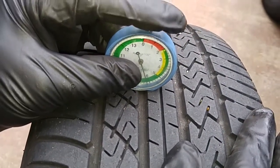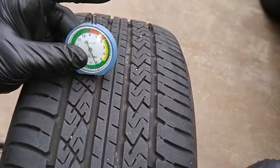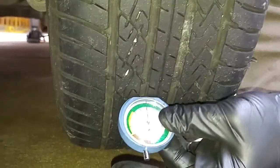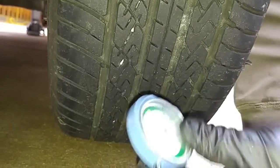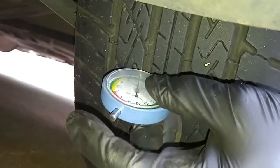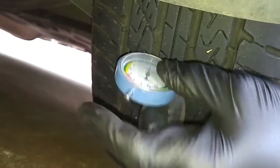The tire that has the least amount of wear, you put in the right front corner of the car. The one that has the second least amount of wear, you put on the left side. And then the ones that have the most wear, you put in the rear. Then you keep taking measurements like every 6,000 miles or so until the wear on the front tires catches up to the rear. Then you cycle the rear tires back to the front.